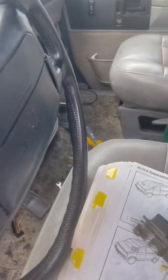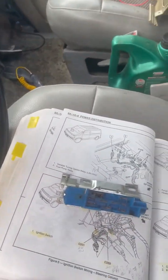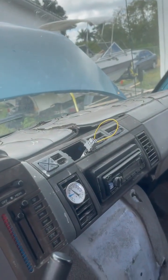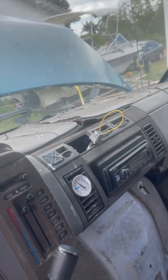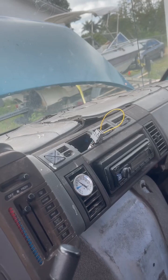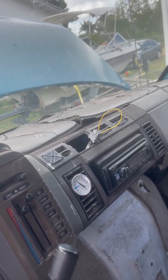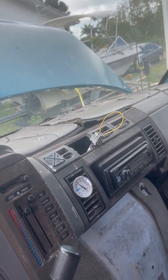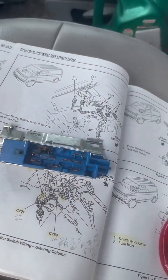The other failure scenario is the A-pin burns out, and that usually happens because they didn't rate it properly for a dual air or dual heater. This van has dual air, front and rear, and when I would put the fan on high — which you'd like to do here in South Florida in the summer, especially towing a boat — you want the air to circulate in the cabin. It would burn out the ignition switch, and I've had to replace this switch several times.